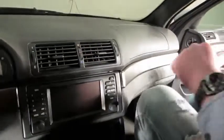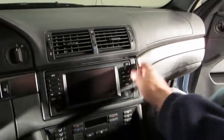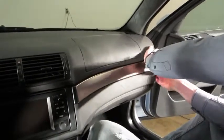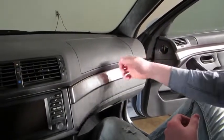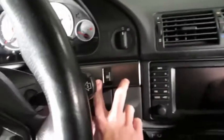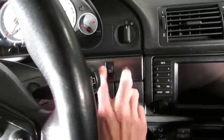I'm going to take on the driver's side; Colton will work the passenger side. The first thing is to remove the trim in here — whether you have the Titan line or wood, it works the same way. Grip the side and pull it out. You can use a little pry tool if needed, but be careful not to chip the trim edge, as that's how big pieces peel off. Peel off the passenger finisher, and on the M5 watch the tire pressure monitoring button — make sure to disconnect that.